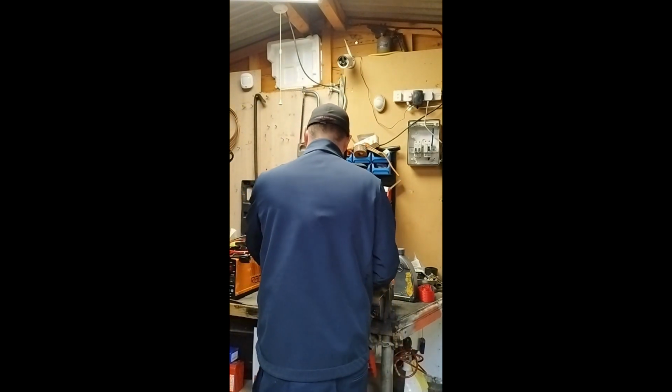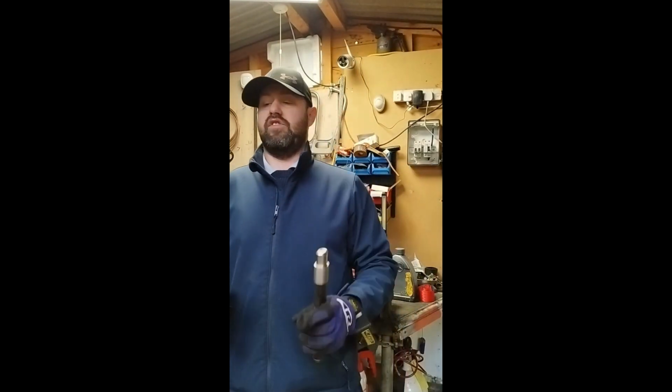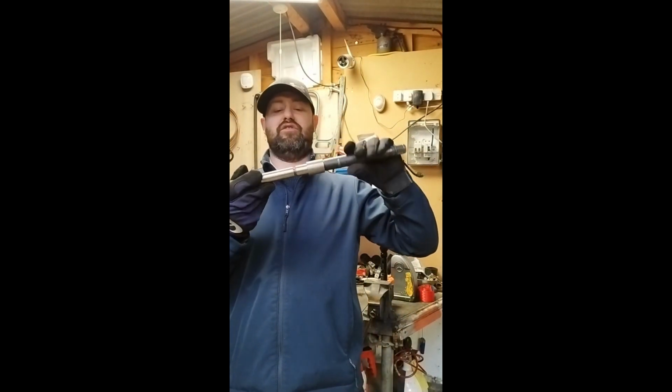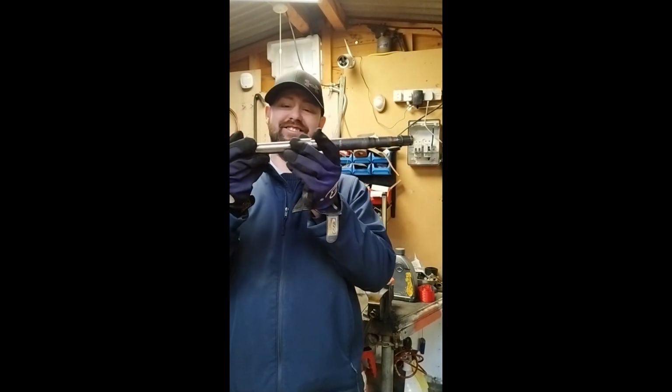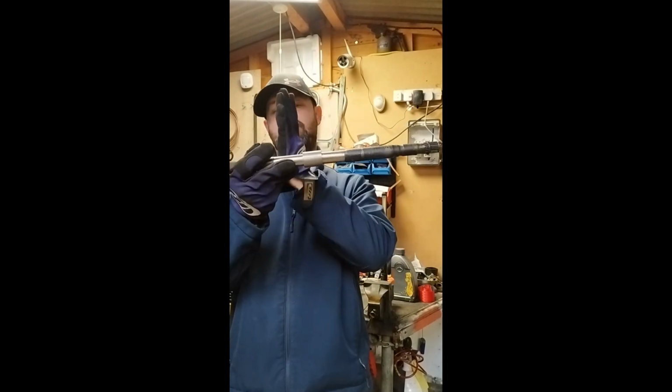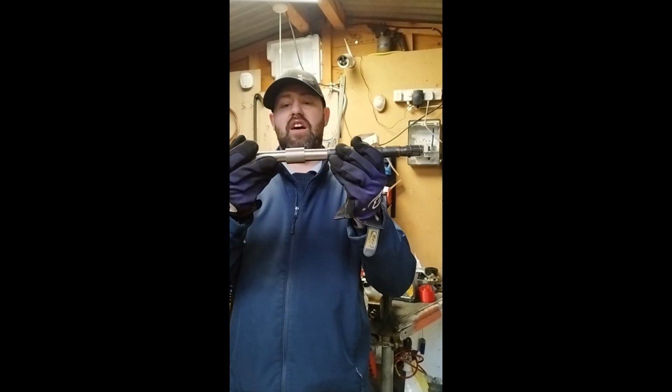So obviously you need two drive shafts. So this is the other side. So put them together like that. Look at the fit. And then slide that across there, weld that. So again, Mini outer, Micra inner, and then we'll weld them.